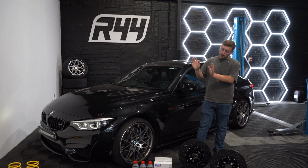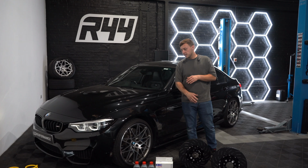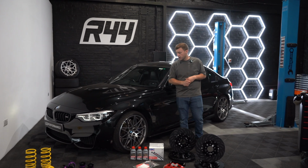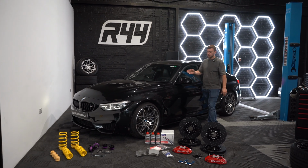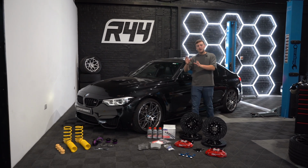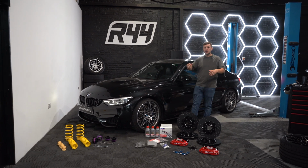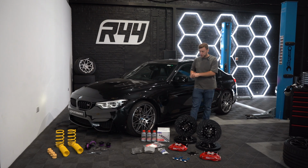And I'm a lover of KW. I really appreciate the quality, the spring rates they choose, and just out the box perfectness pretty much. We run them on a fair few of our cars, so big shout out to KW, and this kit is really good for this car. It's going to give us some ability to adjust the suspension, which allows us to corner weight the car, as well as adjust the rake and some of the adjustments for when Rupert takes this on track.